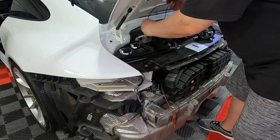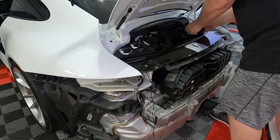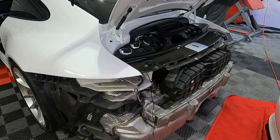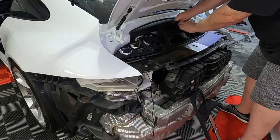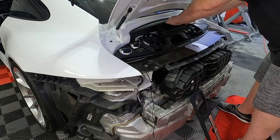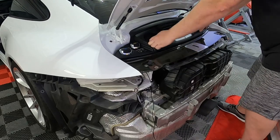Now you don't need to worry about this wire overheating. There are other wires behind there you can see. And if you keep it behind the trim and away from the engine, you'll be just fine. And as you run it down into the engine compartment, into the lights, again, if you just keep it on the right side of the heat shielding, you'll have no problems.